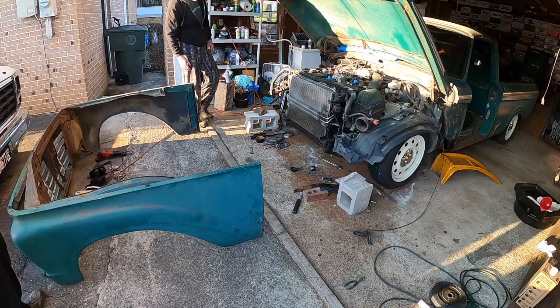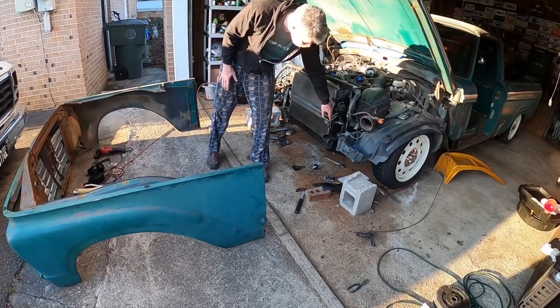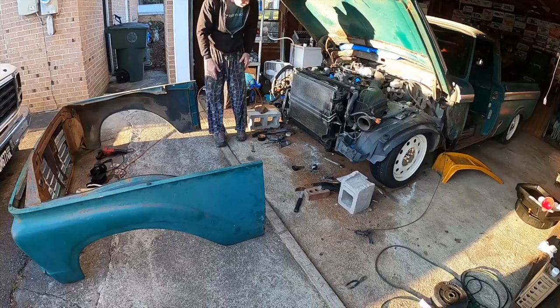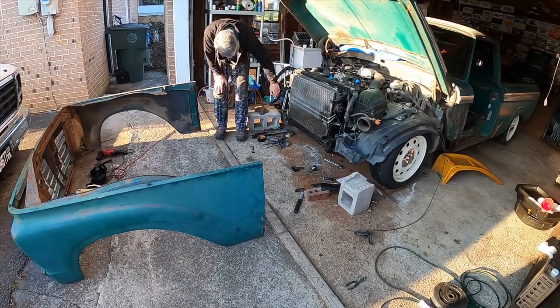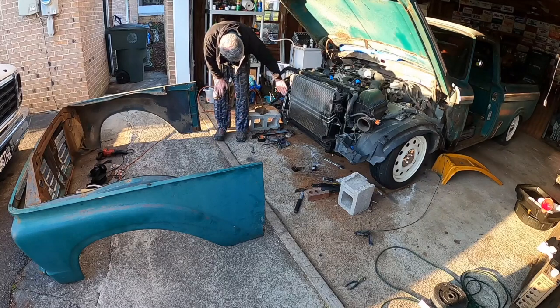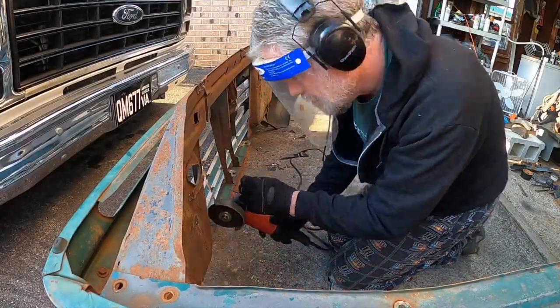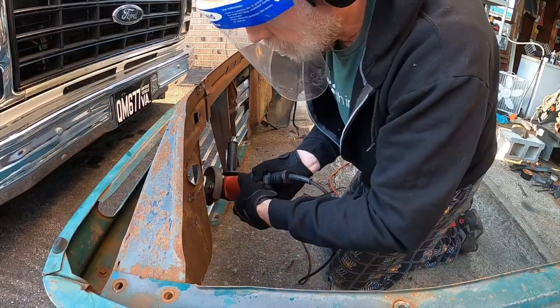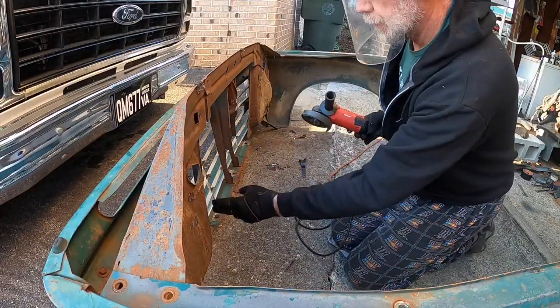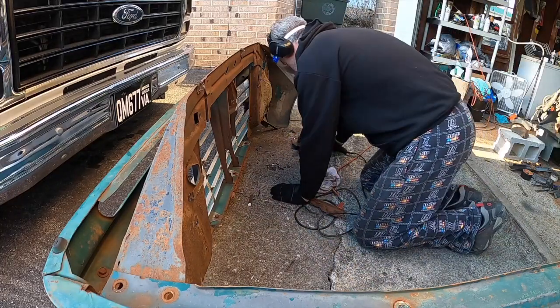All right. So what we got to do now is this area right here, these two lines, we're touching those with the edge of the core support right on the side of the grill. Then over here, these kind of angle, you can see how it starts over here and it angles back this way, and this one does just a little too. So we're clear down here, but once we get up to about right there, it's coming over. So I've got to notch out, you know, half inch or so to clear these as it goes up this core support. So that's got that side to where those two little lines could fit in there without rubbing. And we've got to hit over here.